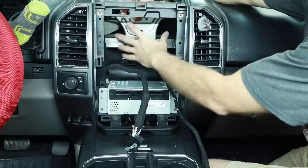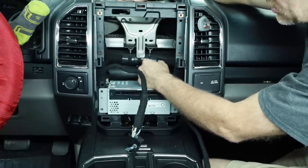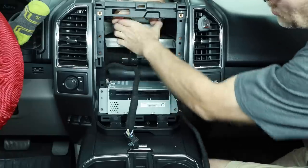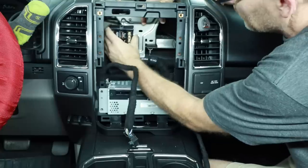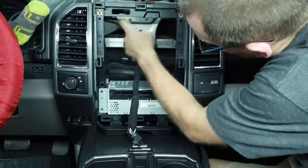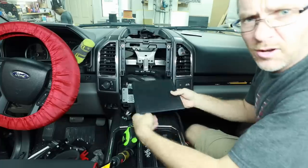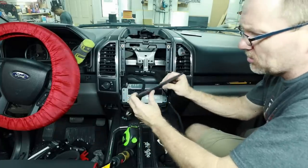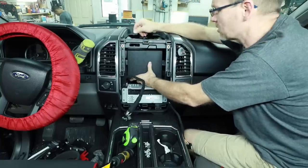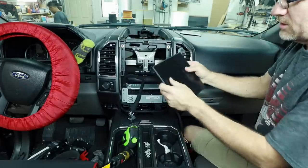To make room for what we want to do, there's plenty of space right here behind the radio. There are two nice big screws at the top for us to attach our panel, and a third screw we can remove. There's also a panel across the front we remove, giving us a giant area to mount things. The plan is to mount the two crossover networks here and here, and the LGDs below, so the wiring harnesses can come up from the bottom. Seven and a half by seven and a half appears to be the winner for panel size. We cut up some quarter-inch ABS — it's more rigid, which is nice when mounting in an area like this since the truck is going to bounce around.